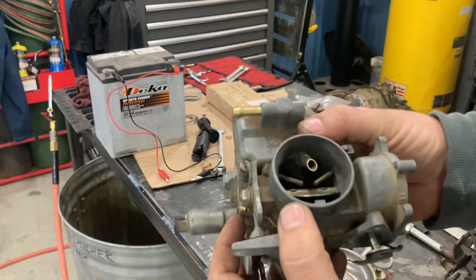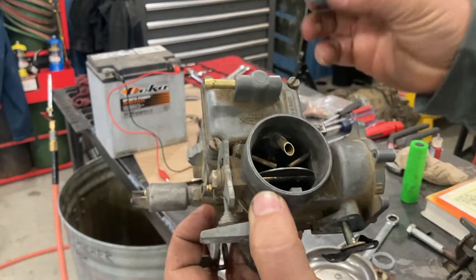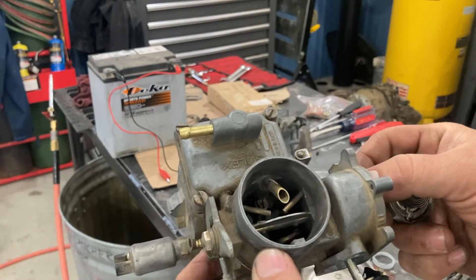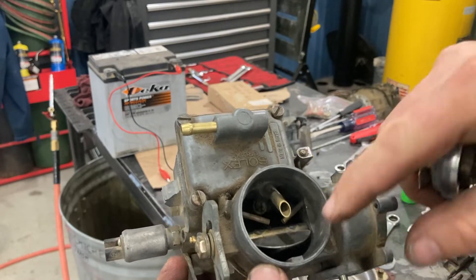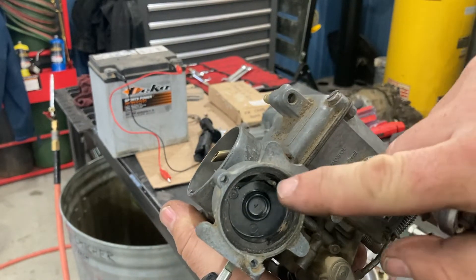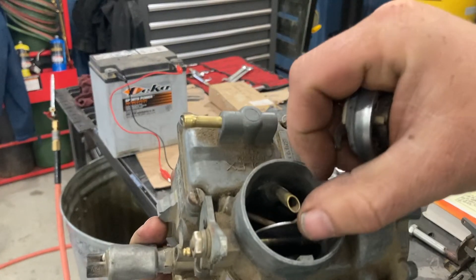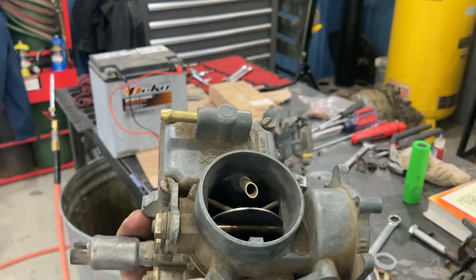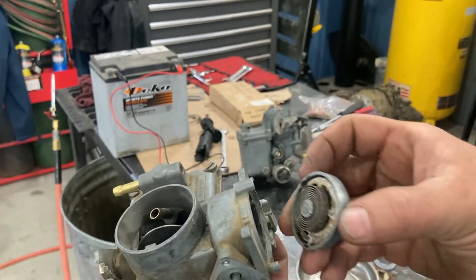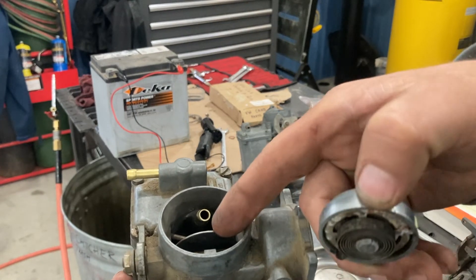So I want to show basically the idea of how to set the choke first, but then I'm going to show you how the choke physically works, and I think it's going to be kind of interesting to those of you who are into these cars. The butterfly at the top here allows the choke to activate, and that's controlled by this little lever right here. You can see that as I rotate that, the butterflies are moving inside the carburetor. If I set it to the wide open position, there's no choke on at all. The arm inside the electric choke piece hooks to that lever and then closes it as you go to set the choke.